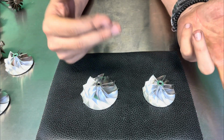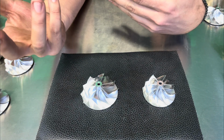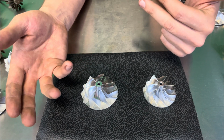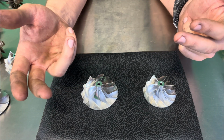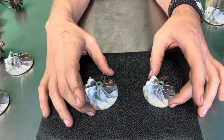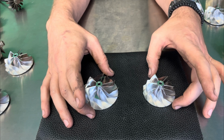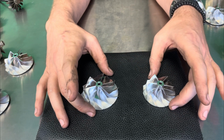91 versus 93 octane, which is 98 in the rest of the world, but if you're running, let's say, half E85, half 91 to get you to 96 octane, which we have some customers that go that route, you'll definitely be around the 400 horsepower range without any issues between the 19 to the 22 range.